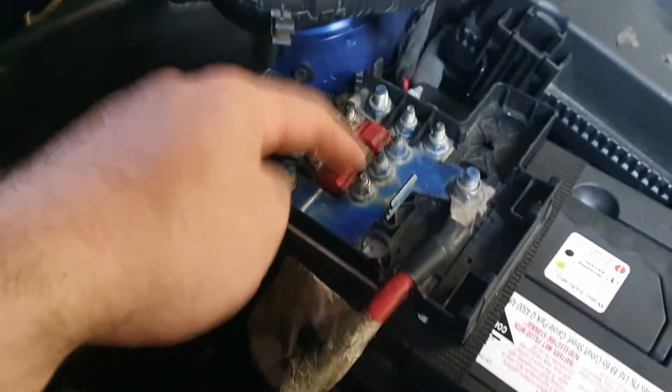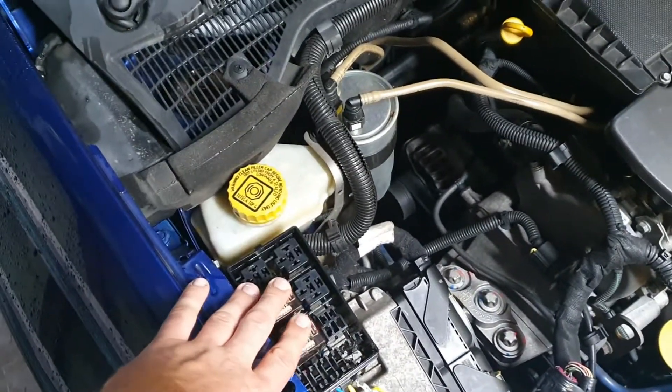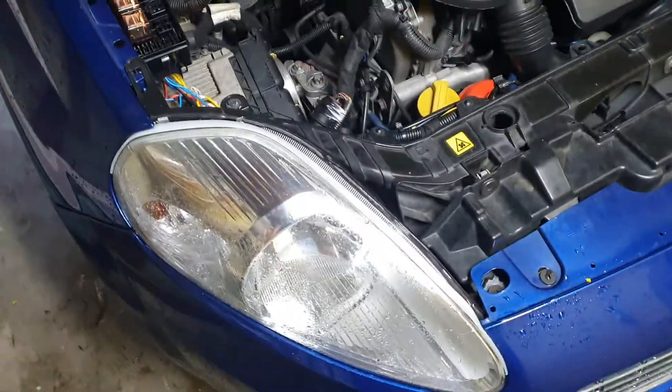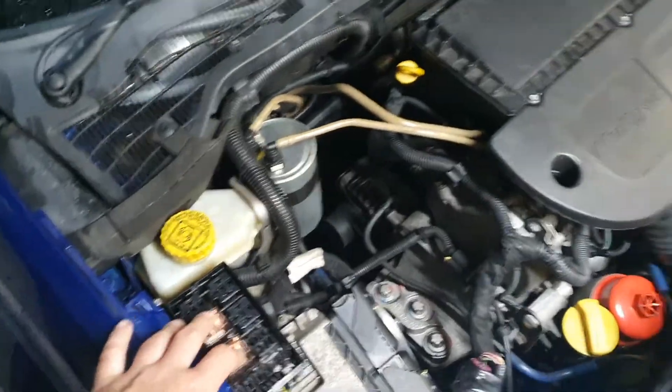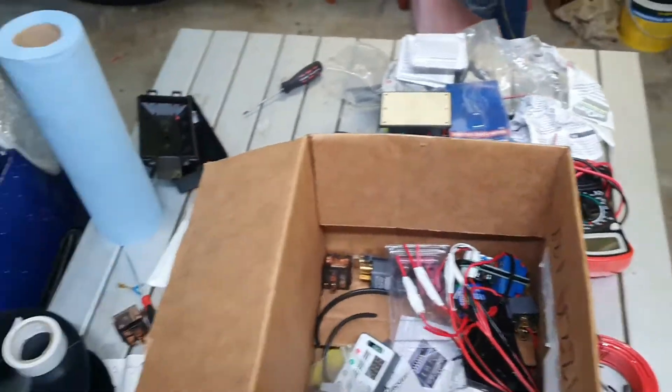It is inline fused, which is a good thing as well. There's the ground wire there. But that was simple enough — you just had to think on it for a little bit. And there you go — if you have that problem where you're doing that, that's certainly a cheap fix. So you don't have to waste all your time on these Narva bloody relays.